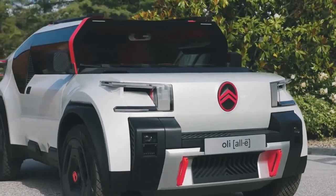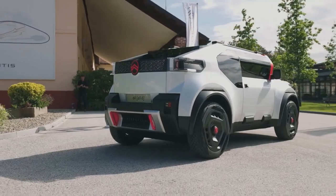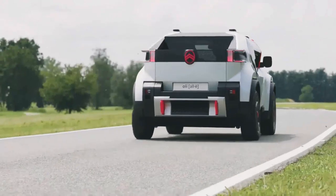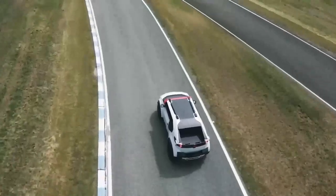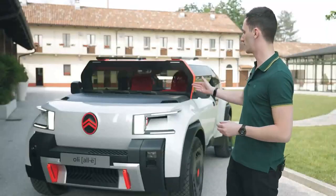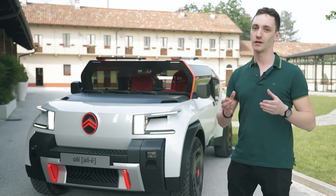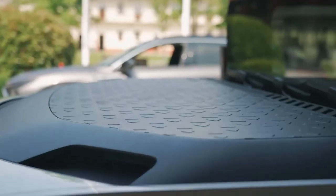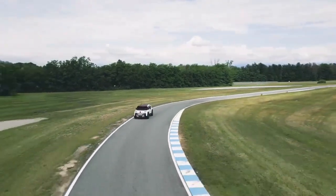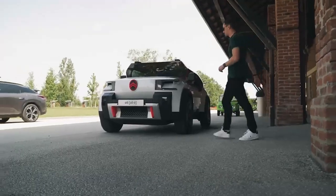The core of Olli's design was to create, like we did for AMI, a design which is accessible. The way we did it is to have the same bumper front and back, the same door left and right, and the use of flat panels to reduce the cost and the mass of the car, making it really sustainable. Every black part that you see on the car is a honeycomb cardboard, which is very light and as strong as steel. The particularity of this material is that it has to be flat, giving Olli its very unique silhouette.